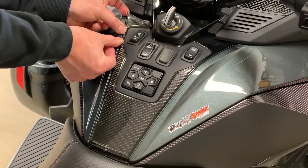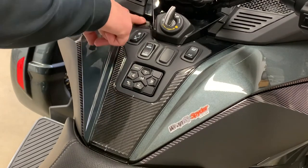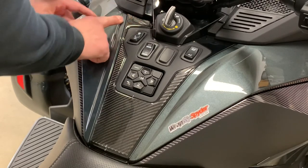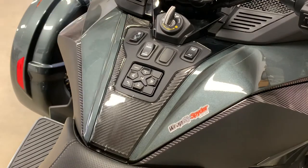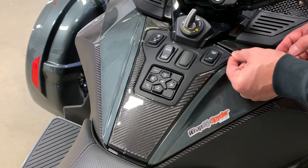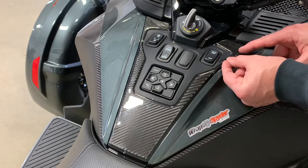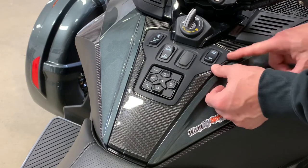Tack the inside corner right there, then look at the little leg here, making sure it's in place, and tack the leg. With fingers underneath that corner, work from the inside — by the key — out to the outer edge, getting it to fall into place. Then do the other side the same way. Watch your alignment, making sure you're right on the inside on the black, following that edge, and then just guide that leg into position — and there it is.